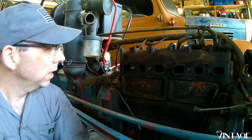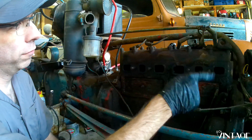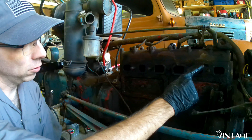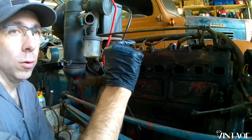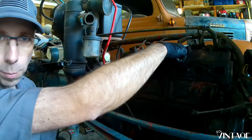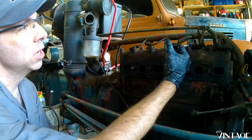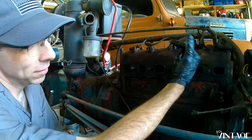Okay, so the compression is bad and we need to figure out why. There are two main reasons why compression can be bad. First, we could have the cylinder rings, which keep the oil out of the combustion chamber, leaking. The other possibility is the valves could be leaking. The way that we find that out is usually with a leak down tester. You put a gauge and a tube into the spark plug hole, bring your cylinder up to top dead center, pump in some air from an air compressor, and you watch the gauge to see how much air is staying in the chamber and how much is leaking past either the valves or the rings.